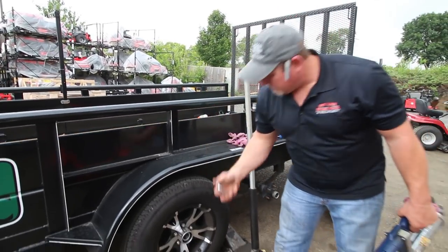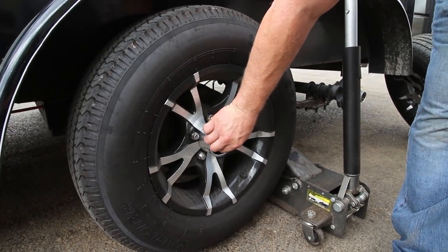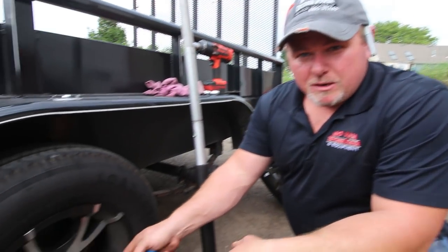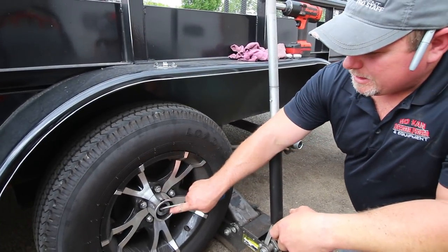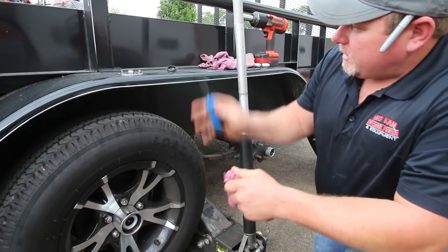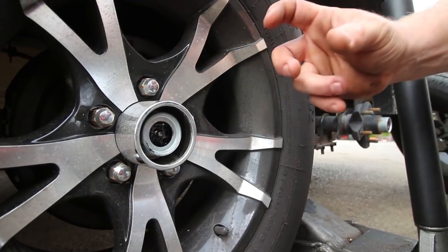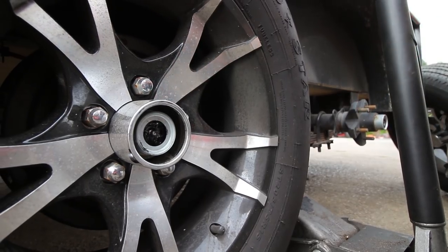Andy's trailer has these nice little caps that come off the outside of the wheel hub or hubcap, so you can get to your bearing buddy. Now, if you do not have bearing buddies on your trailer, it's really easy to add them. Go to your local hardware, auto parts, or trailer store and take your cap in once you remove it. Tell them you want bearing buddies — it doesn't matter how old or new the trailer is. Bearing buddies are lifesavers. Basically, it's a rubber cap that goes on the outside with a grease zerk already built in, and on the inside there's a plunger on a spring that always keeps pressure to ensure you have grease in your bearings.